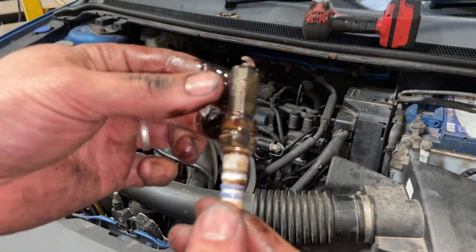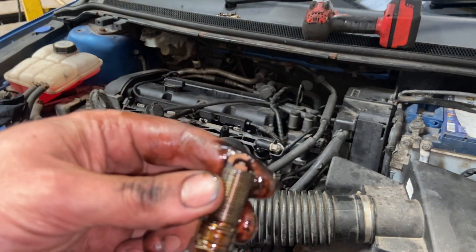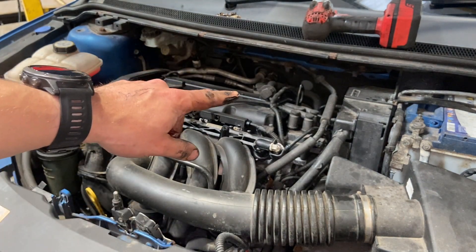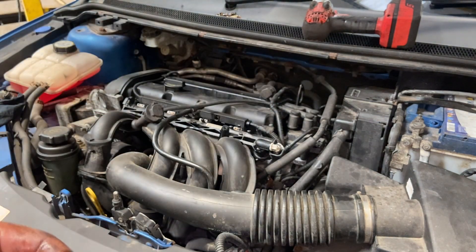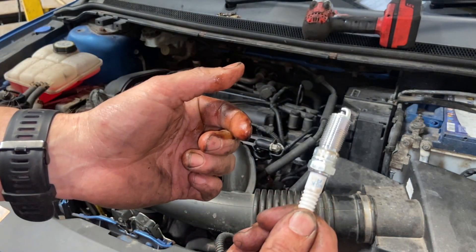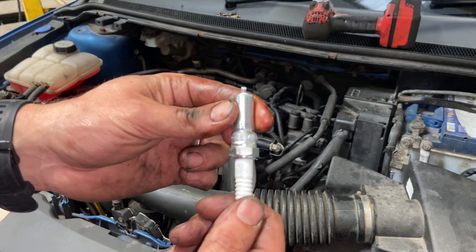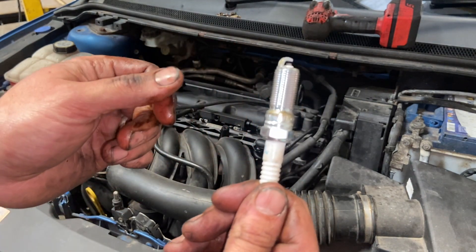You can see how much oil's in there and the state of the spark plugs. I've also got a video on the rocker cover gasket coming in the future, but if you check out the cam belt video I've done on the same engine it pretty much shows you removing the rocker cover, as you need to take it off to set the timing marks. I'll put a link above and in the description. Now I'll run all the new spark plugs in lightly — the torque setting is 15 newton metres. Without a torque wrench, 15Nm isn't much — just a little bit more than a light nip.